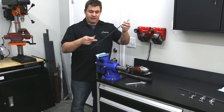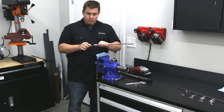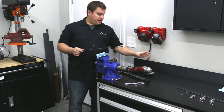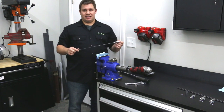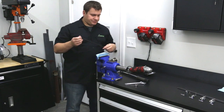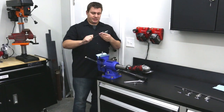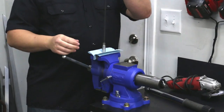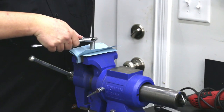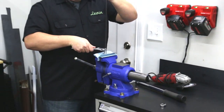Now, cutting this rod — it is a carbon rod with glass fibers in it. We recommend cutting it with a high-speed rotary tool such as a Dremel or a cut-off wheel. Wear safety glasses, wear respirators, wear everything — this stuff is nasty and you do not want to get it in your lungs. Please wear the safety equipment. Once you cut it down to your preferred length, take your other collet end, put it in the vise just like before, tighten that down, and you're set. We recommend lining up both ends so they're in line as they'll sit on the vehicle.